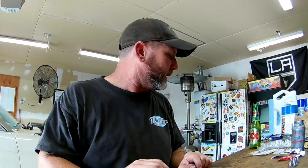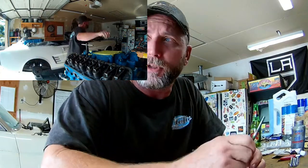You saw me use my favorite stuff today — lots of anti-seize, a little bit of RTV, and some red Loctite where applicable on our hardware. One of the things I didn't do when I got this new long block that I should have done — and what you guys need to do before you put together your new motor — is chase all your threads out. Make sure that when you go to put your components on your motor, everything's going to thread in nicely. I had one bolt on our intake that I had to chase the threads out of, which means I could have potentially dropped some carbon or rust scale down into our intake valley. So we're just going to have to flush the motor out, maybe do an extra oil change, and hope anything that came loose will get flushed out.